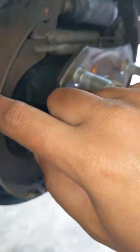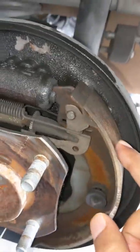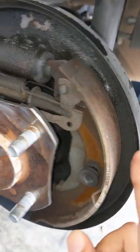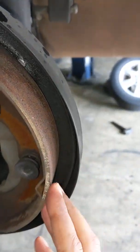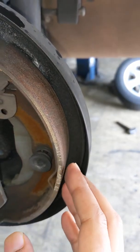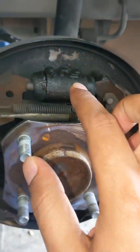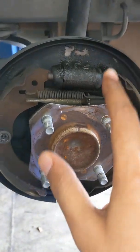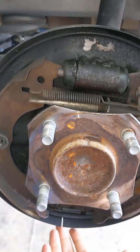Not only that, this is also plain — there's no pad left on this one. I do have pad here because this is what happens in a car: the front brake shoe pad goes off, while the back pad, because the pressure doesn't fall that much, stays on. But look at this — this is so dangerous. You can't tell whether or not you're having a brake fluid leak because there's no fluid visible here, right? All the fluids are stuck inside the wheel.